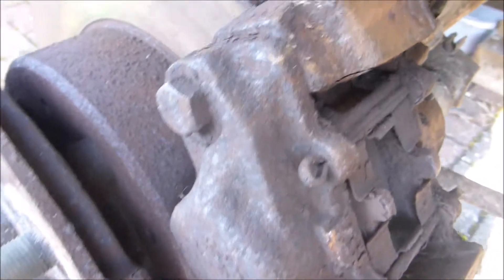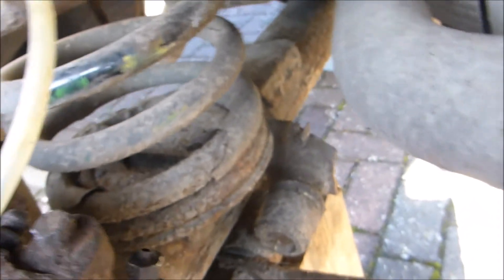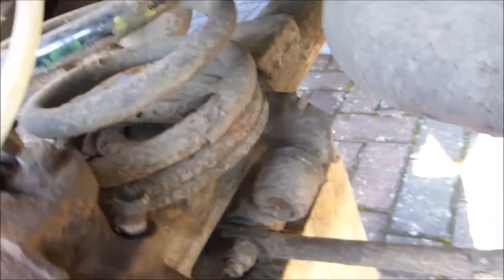I started on the back axle. You can see in the back there's the caliper, and you've got this brake union nut — or bun nut — at the back. Now, whatever you do, if you're going to change them all, don't bother trying to save anything. Put new ones on.